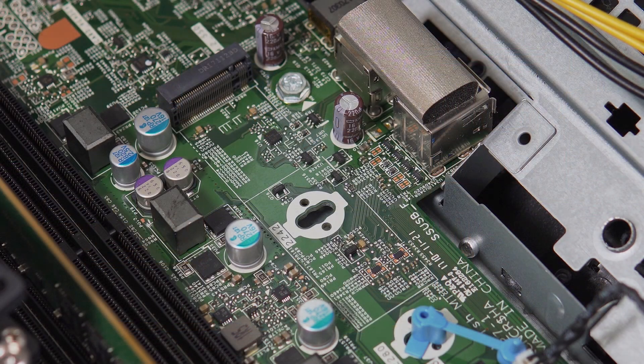Oddly enough, the 20 series micro has an M.2 slot and can boot from it. I believe that's also the case for the ultra small form factor, but don't quote me on that. Dell had the ability and chose not to add that feature to the other systems — granted, it was early on for M.2 and those systems didn't have an M.2 slot, so it makes sense they wouldn't add that ability.